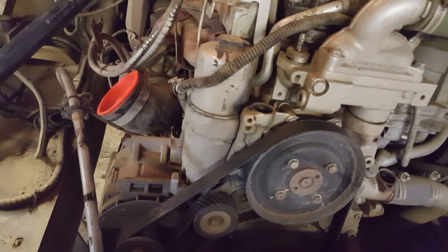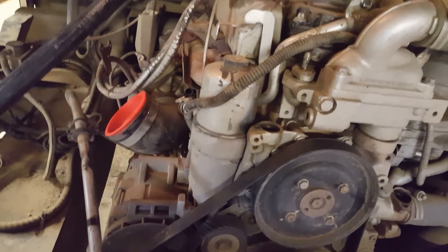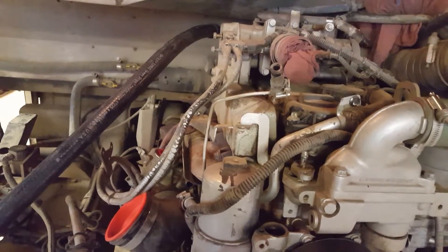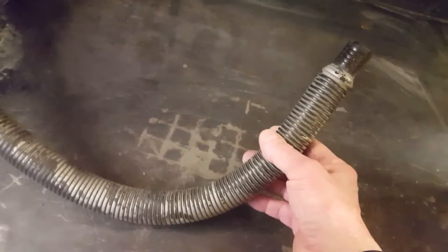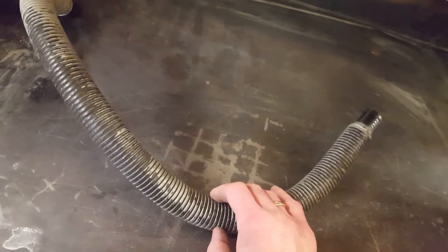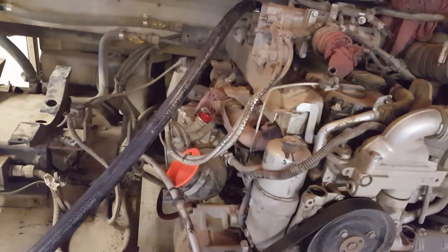The recommendation was to check the air intake to the compressor, which we did, and we found a cracked plastic bellows-style hose from the factory. I've got a sample here — it's very brittle, and as far as plastic goes, it just doesn't last. We found a split around the corner, not a gaping hole, just a couple of splits where it wraps around the corner.